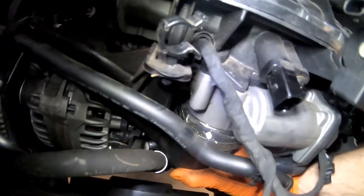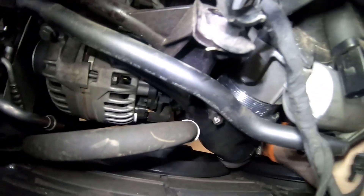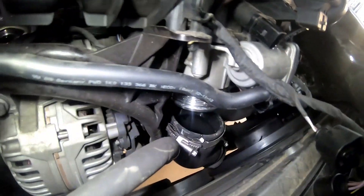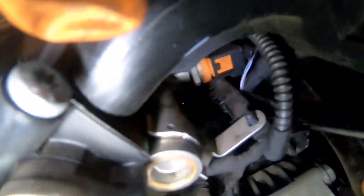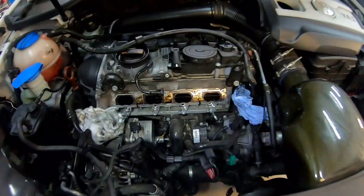Getting the boost pipe off the throttle valve now - it's a tight fit and tight on the throttle body as well. Try not to tear the pipe when removing it as you will create a boost leak. We've got a triple square 10 here - that aluminium support is bolted into the block and to the underside of the inlet manifold. Got to get the fuel pressure sensor unplugged - flip the tab up and pull the connector off.